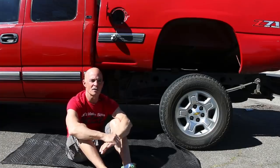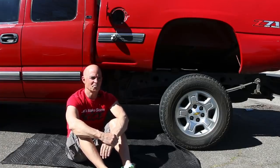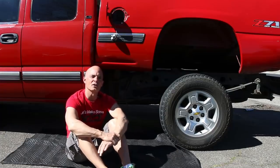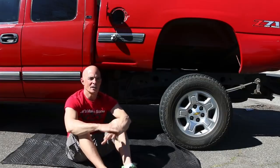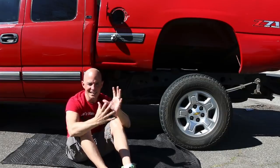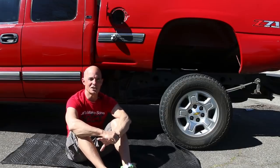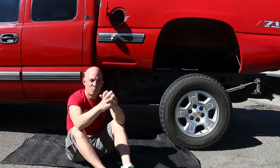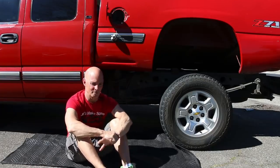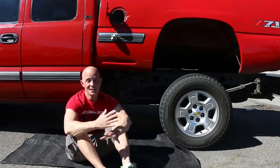Now, let's say that if we were to run it with no restriction, that supercharger at that speed could support, you know, 350 horsepower worth of airflow. We'll just pick a number here. At that speed, with that blower pulley spinning that RPM, that blower processes enough air to support 350 horsepower. Well, the problem is when you take that 350 horsepower worth of air and put it on a 400 horsepower naturally aspirated 4.8, it's not going to make any power. And that's exactly what it did.